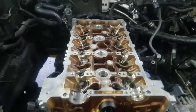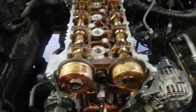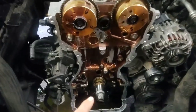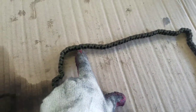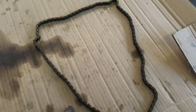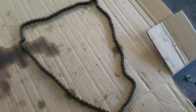After finishing torquing all the bolts, we're going to put the cams. As you can see, already put the cams in place. Now we're going to put the timing guides and the timing chain in place. So now we're going to put the timing — you see these different sprockets: one, two, and three. We're going to mesh these three sprockets on the cam and the crank sprockets.